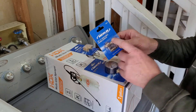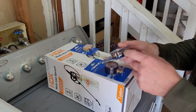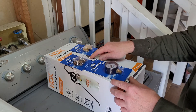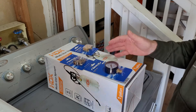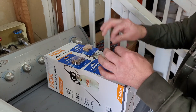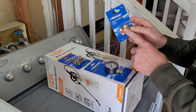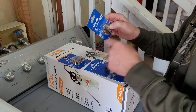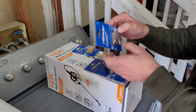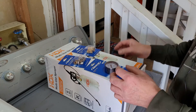You're going to need some kind of quarter-inch barb, and that's to connect the end of the wand to a cap. This kit also comes with a two-way barb, so if you wanted to extend the hose — because this is a very short hose — and if you don't want this canister in your engine bay while you're doing this and want it to sit on the ground, this barb will allow you to add an additional quarter-inch hose. It has a fitting with quarter-inch pipe threading, so I'd be able to put that nut on and tighten it that way.